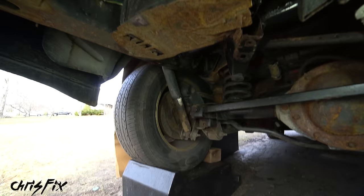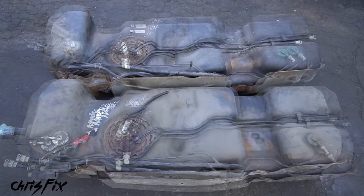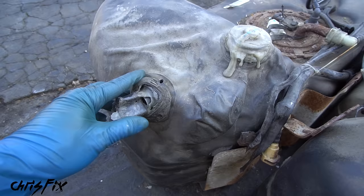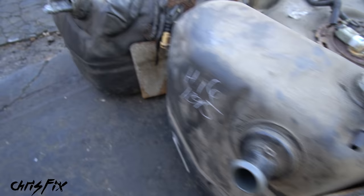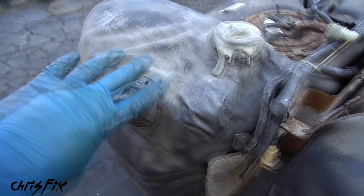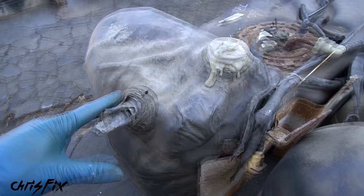Remove the old rusty charcoal canister — it's held in by three bolts — and it comes right out. Out with the old and in with the new — almost new. Check this out: no wonder this car had no fuel in it — it wasn't just a busted fuel pump, it was a melted fuel tank. The fuel filler neck is just melted solid. Compare that to a good one where fuel can easily flow in. The bad exhaust must have caused all that hot exhaust gas to melt the evap lines, vent tube, and everything around there. The owner is lucky he didn't have an explosion or fire.